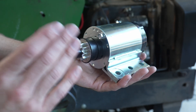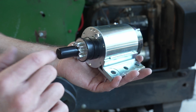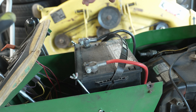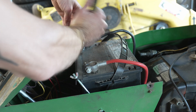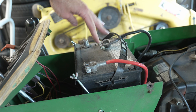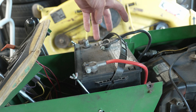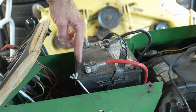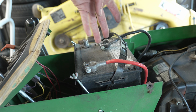There are a lot of way better videos explaining that on YouTube if you want to check those out. I'll probably have one linked down in the description if you want a more in-depth description of this whole system. The first thing that you want to do before removing the starter is disconnecting the ground cable from the negative terminal on the battery. I'm actually going to remove the whole battery and just turn it around, because this positive cable is a little bit close to all of this metal stuff here, so not the safest thing.